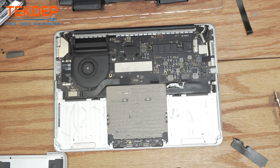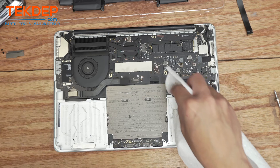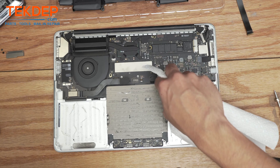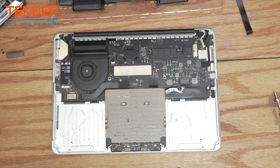We're going to clean up the residue left over from the lithium-ion fire using some paper towel and a little isopropyl alcohol — starting with the bottom case, then moving on to the logic board. We're hoping the logic board is okay given the severity and location of the damage — it's 50/50 to be honest. The reason we're cleaning off this residue is that it could contain ions which, when the board powers up, could bridge capacitors or traces and cause another short. We'll also use Q-tips and cotton swabs to get into tighter areas.